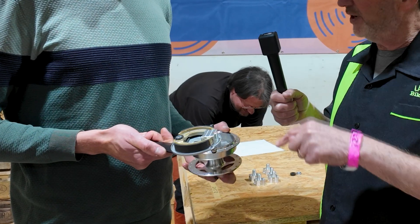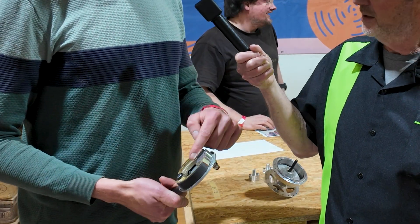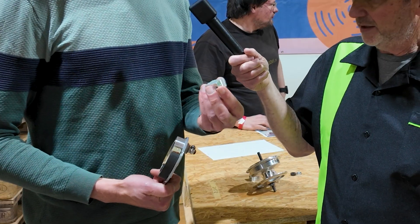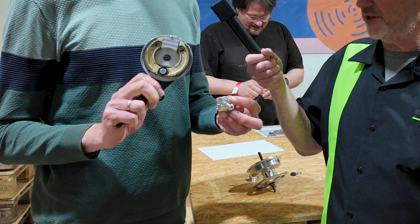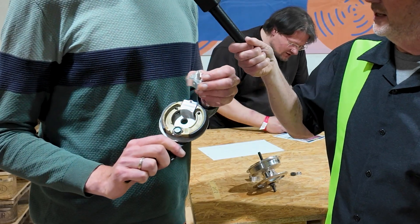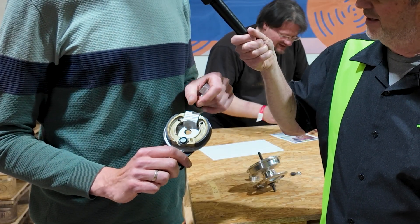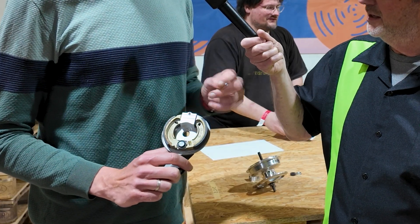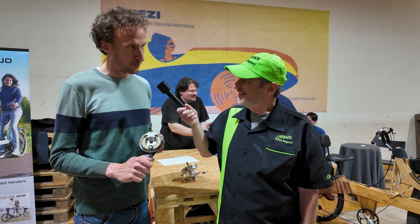Pieter, show us exactly what you've done so that they can see. So I took out the mechanical parts here and built in a hydraulic body with two pistons, which directly push to the brake shoes without any friction, so that creates much better brake performance and brake feel.